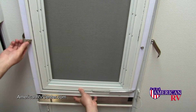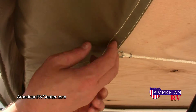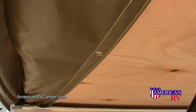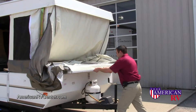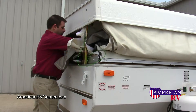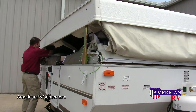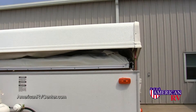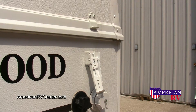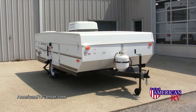Packing up your camper is essentially the reverse of setup. Be sure to remove the door, snap in the safety brackets, loosen all the tent, remove the safety poles, and don't forget the tension strap underneath the beds. Next, loosen all the fabric and be sure to push the beds in. If the beds do not travel smoothly, stop and be sure there is nothing blocking their travel first. Once you've started cranking your pop-up down, stop about half way through and tuck in all of the loose fabric. Be sure to push it in as far as you can and avoid bunches. Repeat all the way around the side of the camper. Next, simply crank the lid all the way down, re-tucking the fabric if necessary. Finally, secure each latch on each corner of the camper. Always be sure to double check your work to make sure all of your utilities are disconnected, jacks are up, and everything is latched down before taking off. Happy camping!